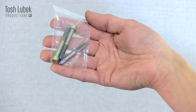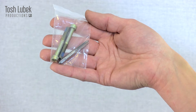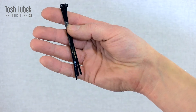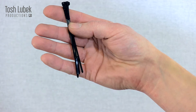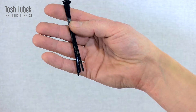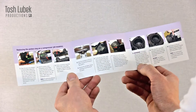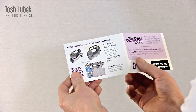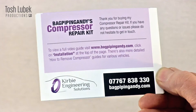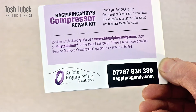You also get two new bolts to hold the cylinder back on, with thread lock pre-applied. It includes an M6 tap to clean out the threaded holes, and cable ties to tidy any cables you've had to cut to remove the compressor. And then an instruction booklet — a step-by-step guide with 10 or 15 steps and photographs to help people through the fitting process, since it's difficult to know the skill level of whoever is reading the guide.